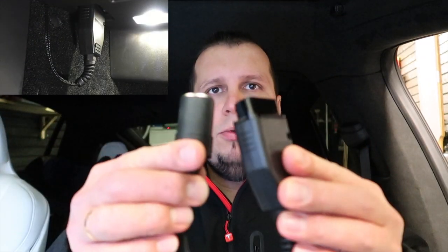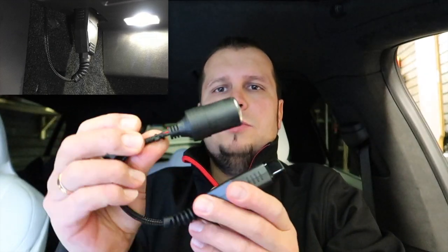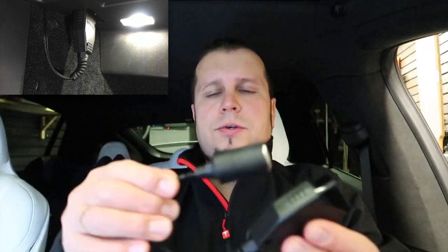In the previous video I showed you how I mounted my Blackview dashcam. Some of you have asked how I connected to 12 volt power, so I made this little cable — it's an OBD2 plug from eBay and a 12 volt cigarette output socket. I didn't have to cut any of the original wire from my dashcam, and it has a fuse as well for some extra safety.